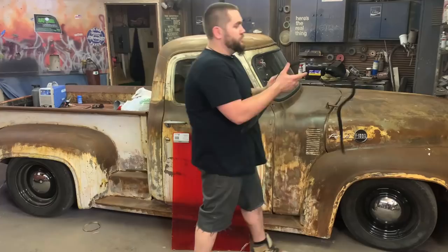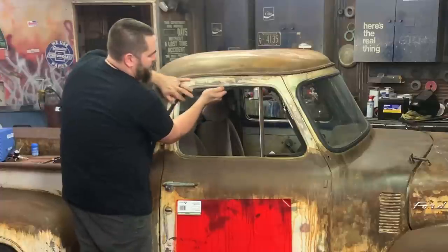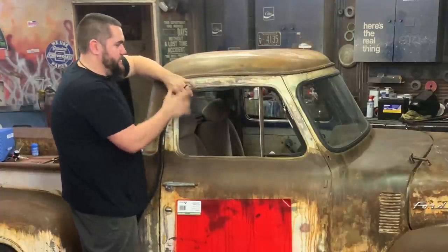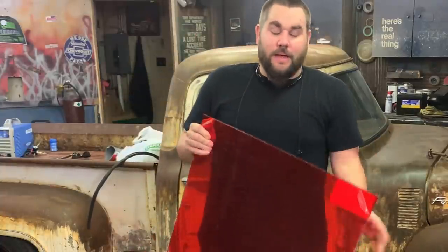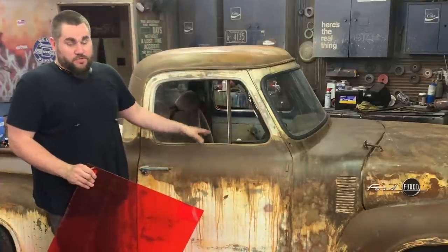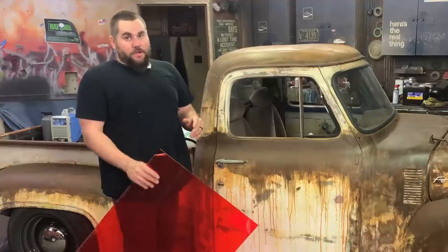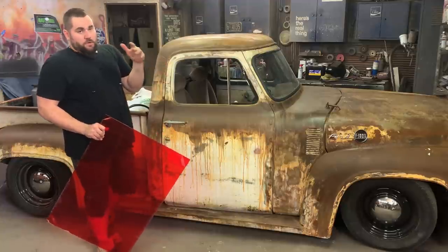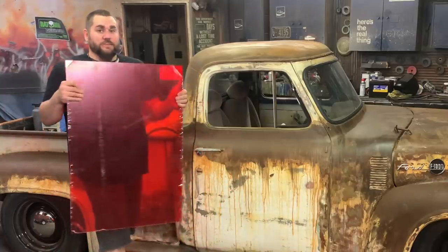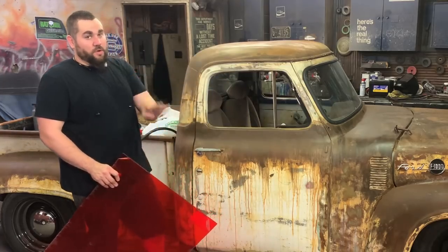I have good news and bad news. The good news is my windshield channel came in. This feeds into your door frame up here and it holds your glass — basically stabilizes it as it goes up and down. Bad news is I can't find clear plexiglass anywhere. They have some like two hours away, but I'm not gonna waste a day driving to get it. This is just gonna be used for a template so I can get glass made. I wanted to use clear plexiglass so you could run it if you had to, but that's not in the cards. We're gonna go ahead and make it out of red plexiglass because they had this in stock. You can really make it out of wood — quarter-inch plywood works really well — but they have red in stock so we're gonna run red. We need to make both sides. Vent windows are their own piece of glass and the door glass is its own, so we gotta make four of these.